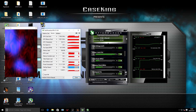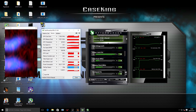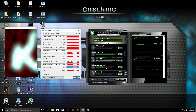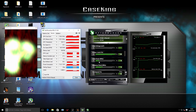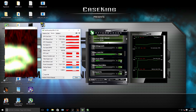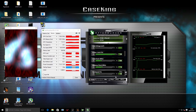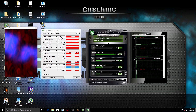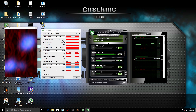I tested four cards in total and you can easily go plus 100 or plus 150 on the core clock — all cards should be able to do that, and some may even reach plus 250. For memory clock, plus 500 should be safe on all cards, and most should be able to do plus 600 or even plus 700. I've also seen plus 800 out there, but it really depends on the card — you just have to try what works for yours.